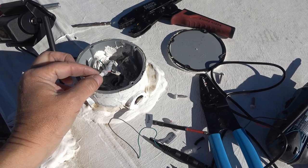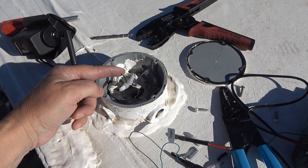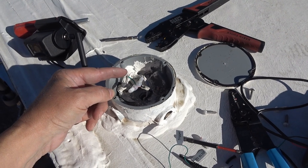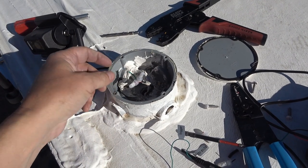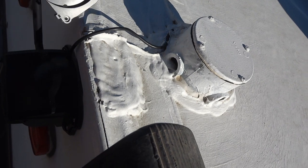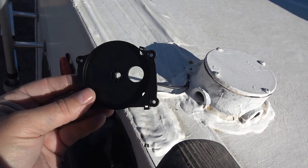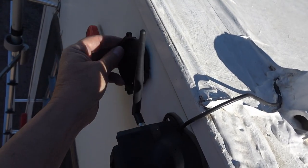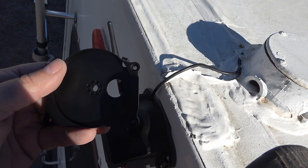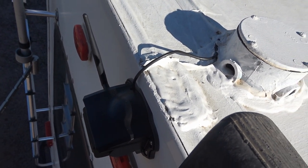Used the crimper with the provided crimps — got a good connection, and the camera is already working with the display. About the green wire: it's a trigger wire for signals or backup, so if you wanted to use this as a backup camera, the trigger wire can activate when you put the vehicle in reverse — but I won't be using that function. Easy install. You can also magnetically mount cameras using a magnetic battery pack that you charge and stick wherever there's metal to mount the camera while towing, but I prefer it permanently mounted.